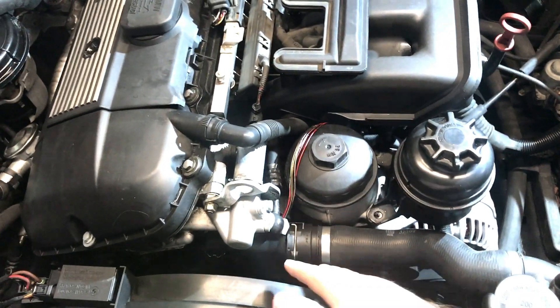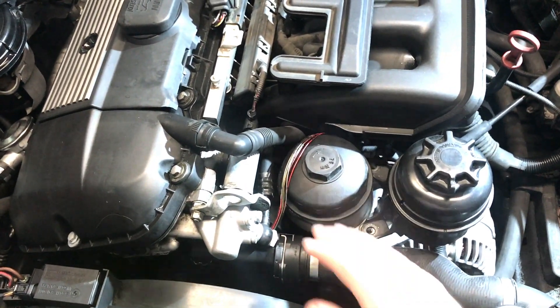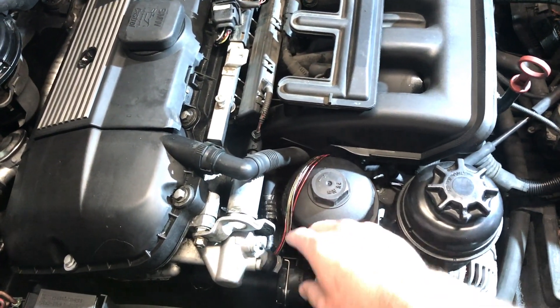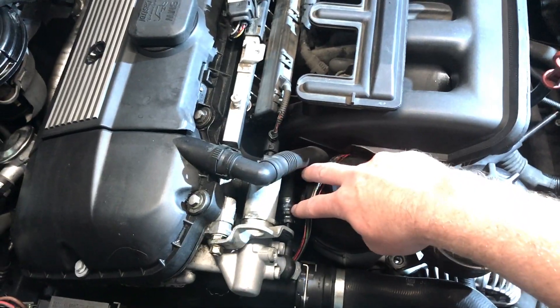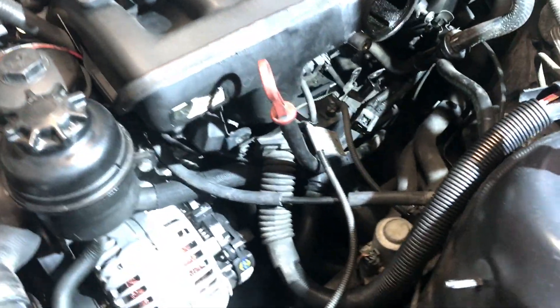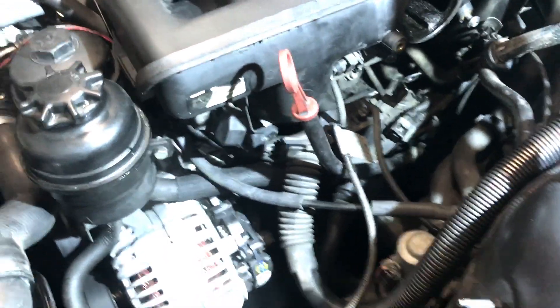You may think it's the water pump or something nearby, or even the oil filter housing will sometimes leak coolant as well. This is coming straight down from two pipes that go into the cylinder head, and we've already taken a bunch of stuff apart hoping to see it in there, but you can't - it's hidden in there.